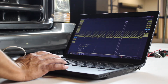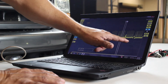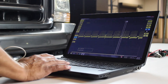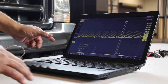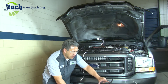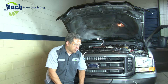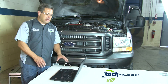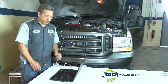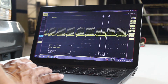We'll hit play again and you can see the timed event coming across each time it happens. Pause again and we catch it. The whole frame is on a 200 millisecond range, so we can count the distances between each and make sure that we're firing correctly. Now I've turned the engine off and frozen the screen so that we can talk about this without the diesel rumbling in our ears. Our indicators can be used for a lot of different things — we can time in between firing events.